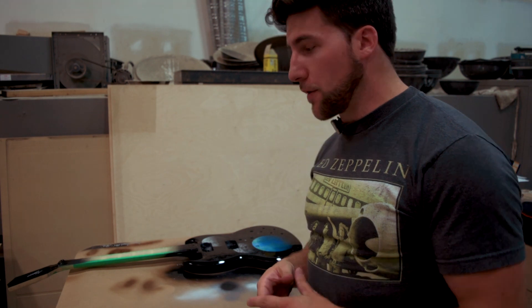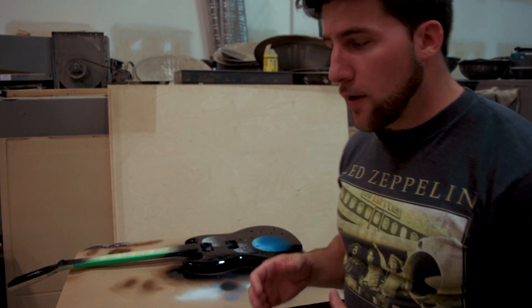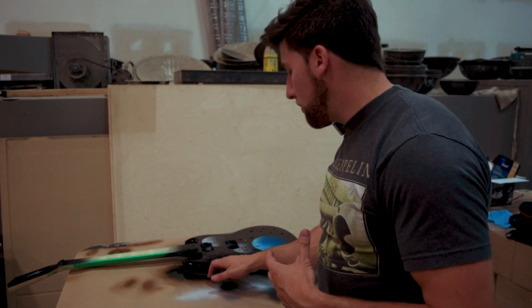It's really warm in here so they were flashing pretty quickly. Sometimes you'll want to wait more like 15 minutes if it's colder. That's a fair bit of clear, so we're gonna come back in a couple days and reassess. Everything should be dry by then. When I go to sand it flat I'm gonna use a block — you can use anything flat, a chunk of wood, whatever. You can buy a block from any of the stores we've talked about.